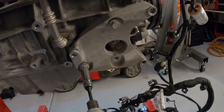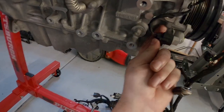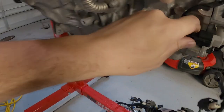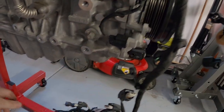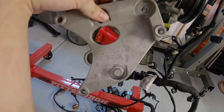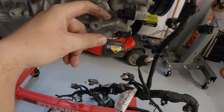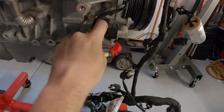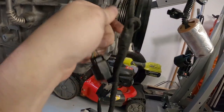There's a ground here and the crank position sensor down here. It's really annoying how Ford did it - you'd have to pull the whole engine just to change a crank position sensor, because this bracket is what the AC compressor bolts to, meaning you'd have to remove the AC compressor to remove the bracket to get to it. That connector was really stuck in there - sustaining another injury in the process.